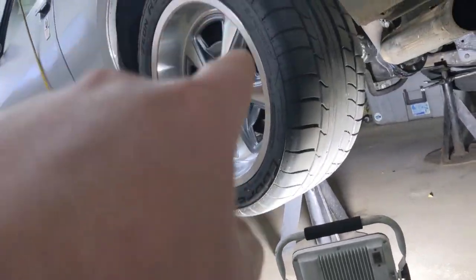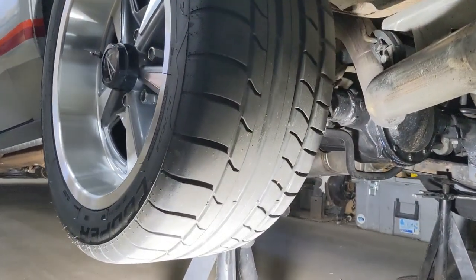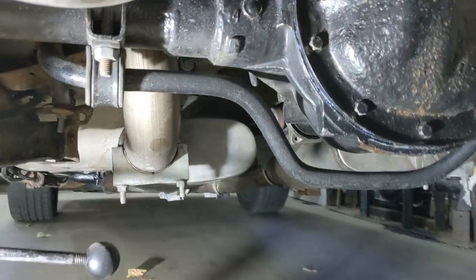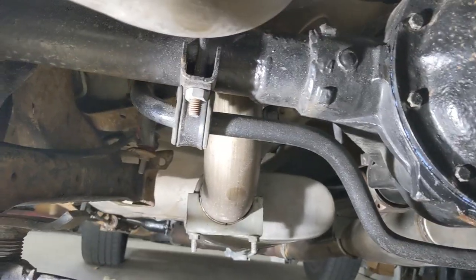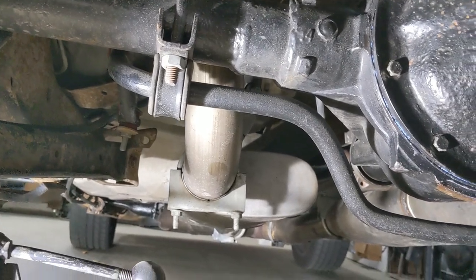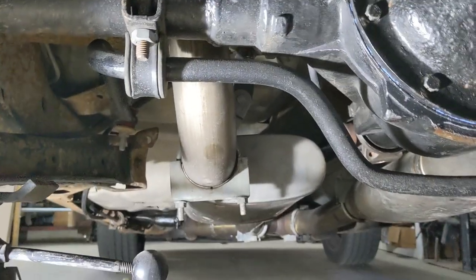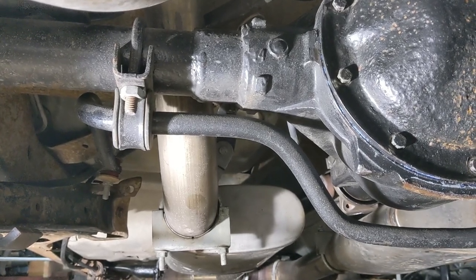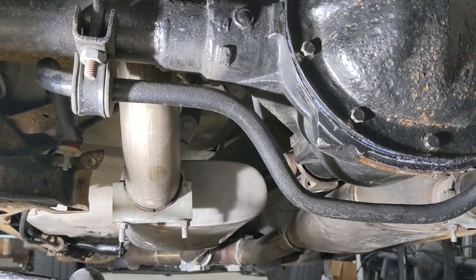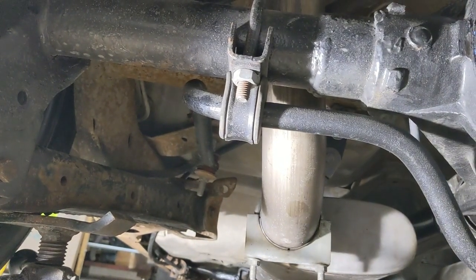One of my issues is I bent that axle shaft and the studs this fall. I have a Blazer — two-door. Works on two or four-wheel drive two-doors. Usually it mounts on the top; I flipped it to the bottom. So this would be on like a '98 to '02, maybe '04, two-wheel drive Chevy Blazer. It is better than the one that mounts on your lower control arm brackets. It's stiffer — it's one inch.